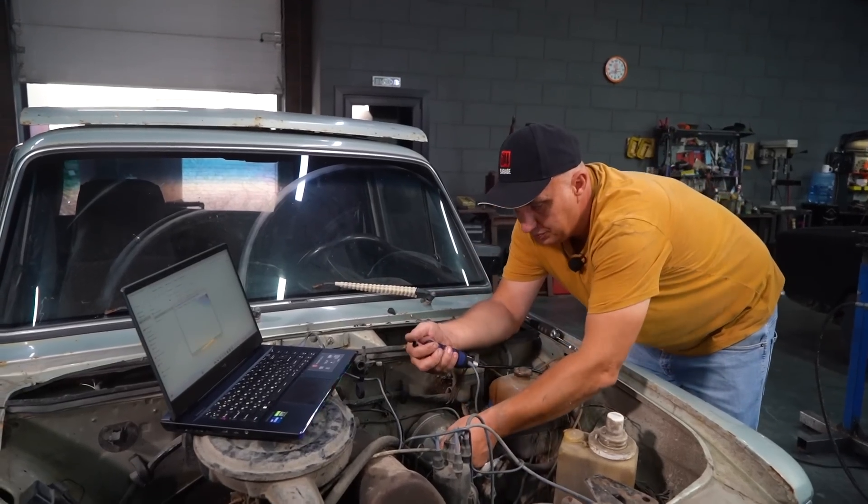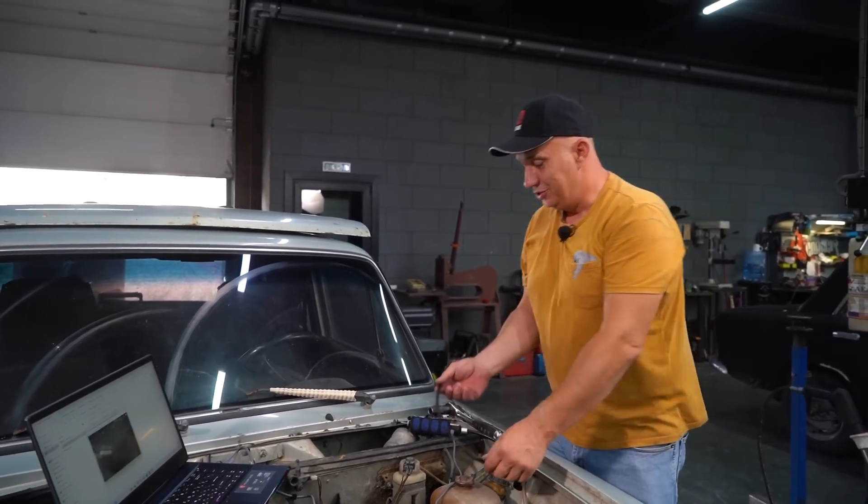Let's look at the head side of things now. This sort of thing tends to occur, but it looks alright. Very nice — there is plenty of buildup. What about cylinders two and three? Looks drier. I don't see any oil. Number two seems to be in fairly decent shape. There is some carbon buildup, but it's not too bad, and there is no oil, which is nice. Number three, there's sludge and carbon. As for the head, it's all about the same as in the others — there's the carbon, we have oil. Yeah, this engine has been used thoroughly and has driven thousands upon thousands of kilometers.